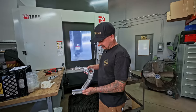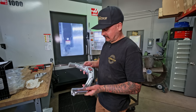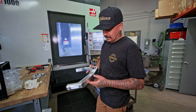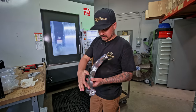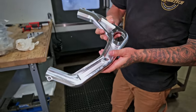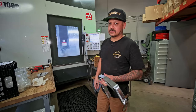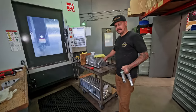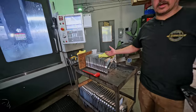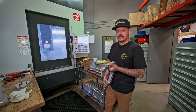Back over here on the five-axis, we've got another set of upper arms we're doing — 2019-plus GM 1500, two-wheel drive and four-wheel drive. We changed it up a bit: added more clearance in this area so you can run a different backspace wheel, closer to a five-inch backspace instead of four and a half. We also added a bunch more clearance for some of the larger 3.0 aftermarket shocks. Obviously our standard toolpath upgrades — lots of surfacing and cool tool paths on these. We came up with a new fixture so we can basically put it in the vise to this point, then a second fixture finishes the part completely. You just pull out a complete part without having to clamp it again to cut out the center section — it's all integrated. We're not going to show you that part so someone doesn't copy our idea.